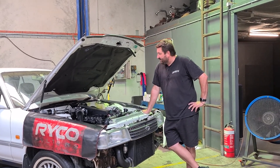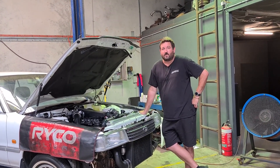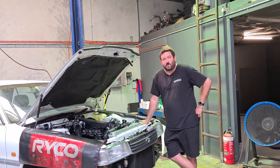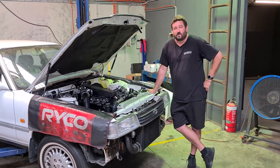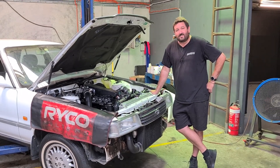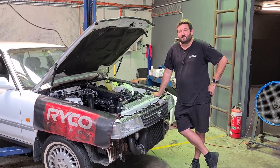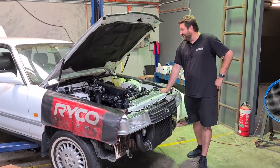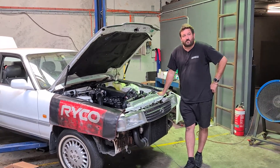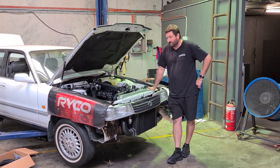I'll be drifting it next — that'll be two cars with coilovers. I've also got 70-series tyres. The suspension's old and crappy, and with the additional weight and no room for a sway bar, we probably need a higher spring rate in the front, so it's going to have coilovers. Just in case we didn't already have enough going on, I think I'm getting a new car this weekend — maybe we can show a bit of that next week. It's the same but different — one of the things on our list of cars to build but it's already done. I'm pretty excited about it actually. Alright, see you next week.